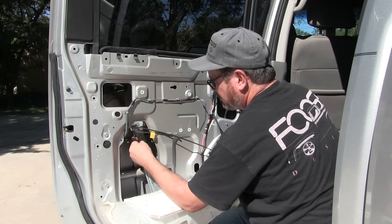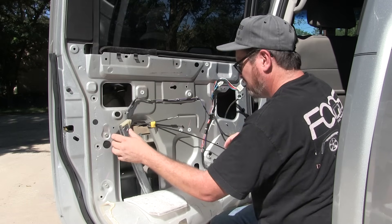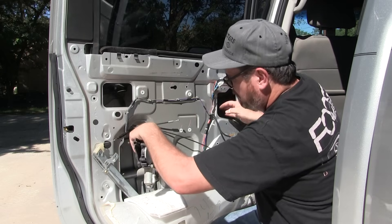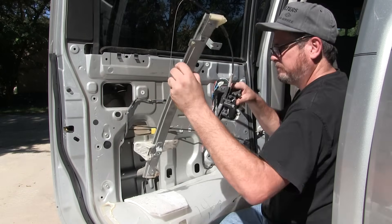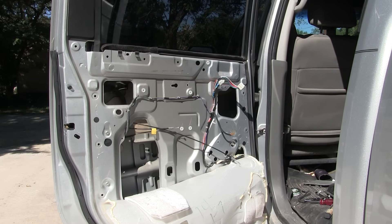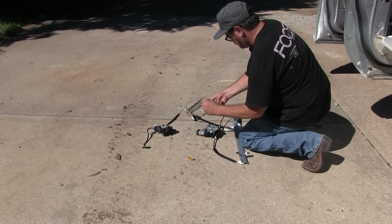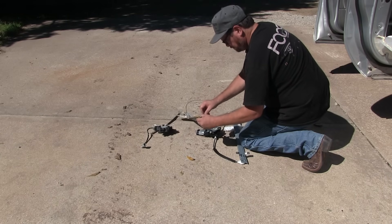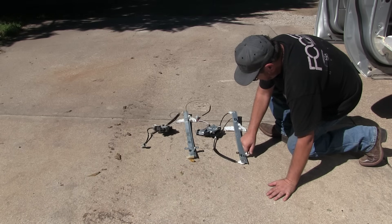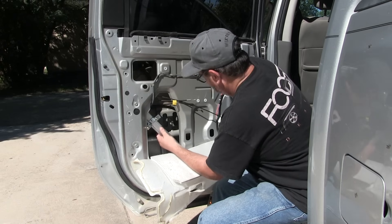You can see how it slid out of that slotted area with the bolt still in the regulator — just loosen that one up. Once you get it loose, start working it out. You may have to adjust it a little bit, but then it comes out pretty easy. You can see this cable is broken pretty badly on this one — that's usually the case. The cable breaks; some of them have plastic straps. This is the most common problem. Once you get it out, make sure the new one is identical: same bolt pattern, same size for the door. Everything aligned correctly on this one, so I lucked out.